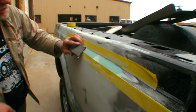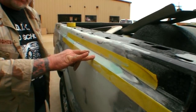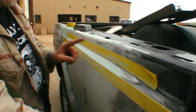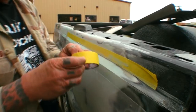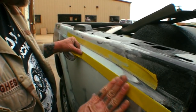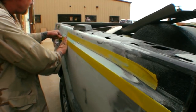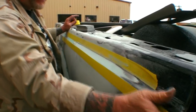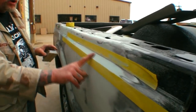I'm going to leave this tape on here — the tape's still good, I haven't cut through it. There was a little low spot back here so we'll work on that at the same time. I'm going to take my sanding block — nice hard block, sturdy firm block, no flex blocks here — and just lightly sand that to feather it out and make sure the color is all the same. Now I'm going to go ahead and pull my tape off, then put fresh tape back on for a nice crisp line. Believe it or not, these edges are very hard to make — that's why the tape method is a real helper.